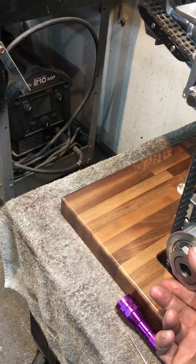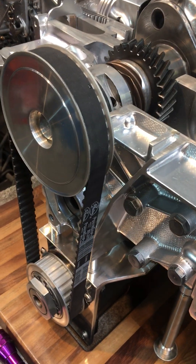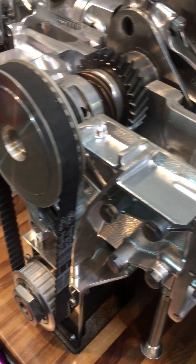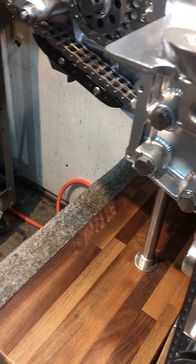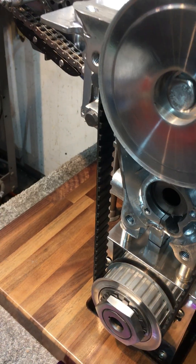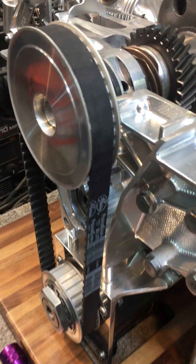For those who have this model, there's a limited slip clutch, and this nut controls the amount of slip. I try to make this safe because I got my thumb in here once and smashed it — it could have been bad. I have three safety devices: one circuit breaker at two amps for motor torque protection, and another at three amps which protects the driver. Ideally, tighten the nut so it normally operates fine but if you grab the pulley it'll slip — that's the safest situation.